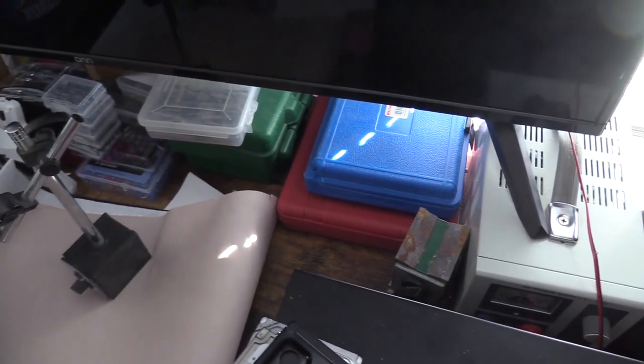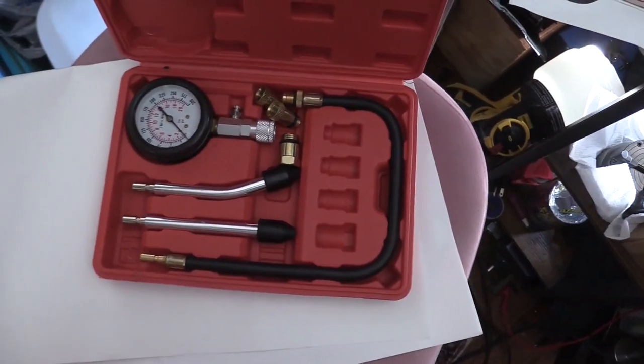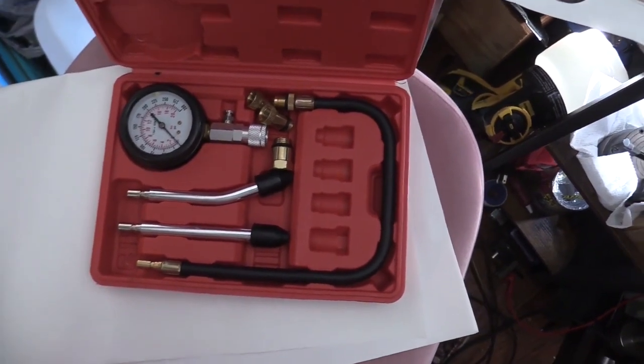The repair manual suggests doing a pressure test. Naturally, that's where the line tester goes. This is a pressure tester. It's got lots of different fittings and stuff. Hopefully we'll be able to figure out what's going on with this. We should be able to measure different pressures in the hydraulic hoses that control the ins and outs of the transmission when we have different controls activated, to determine systematically which parts aren't working.